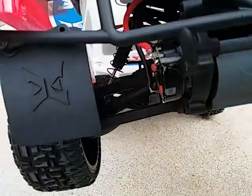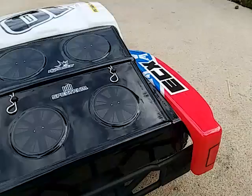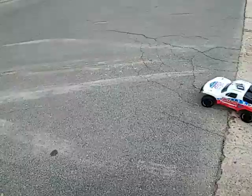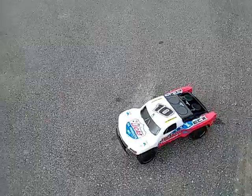What's going on YouTube, I'm back here with the Torment again. I do a couple speed runs - there's the 550 12-turn motor, I got it connected with the 2-cell LiPo. I'm going to get a 3S and probably switch up the motor to a 27-turn maybe, and see what that does. The 27-turn is pretty cheap, I'm just going to goof around with a lot of these motors.